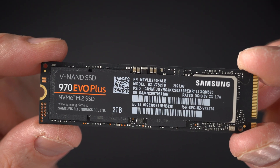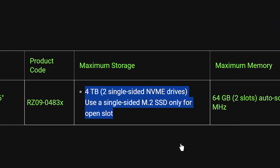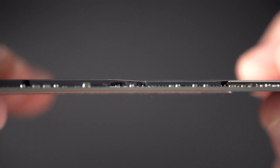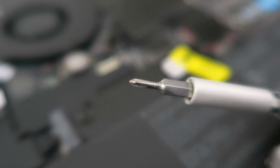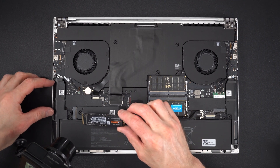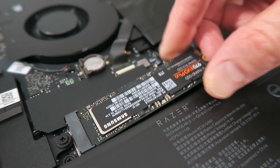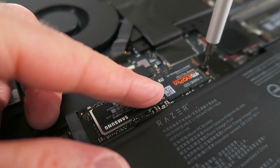For the SSD upgrade I'm reusing my Samsung 970 EVO Plus 2TB SSD. The Razer Blade 16 can actually support larger capacity drives, however because the drives sit on top of each other in a pretty tight space, you can't use two drives that have chip sets on both sides, otherwise the space gets too tight and the whole thing may simply not fit. The SSD I'm using only has chips on one side, so it's going to be fine. To install the SSD, remove the tiny Phillips screw on top of the M.2 socket and pop off the rubber washer. Slot the new SSD into the socket, gently until it clicks into place, push it down, then put the rubber washer back on and screw it back down without over-tightening it.